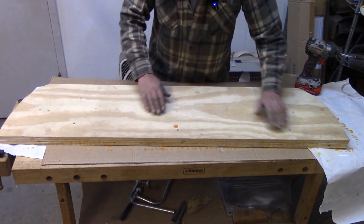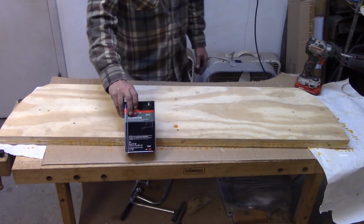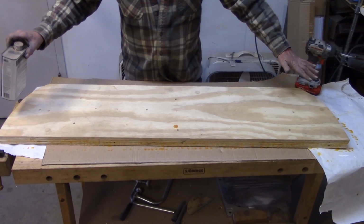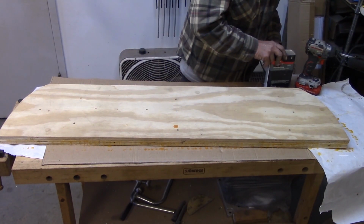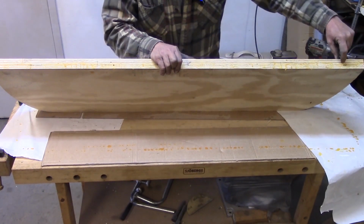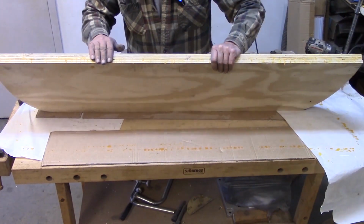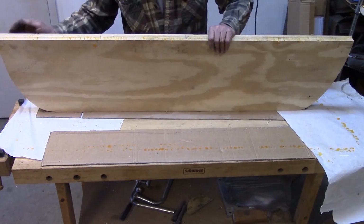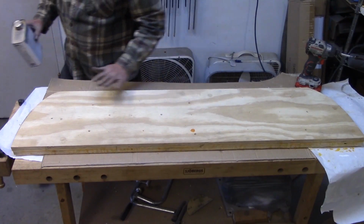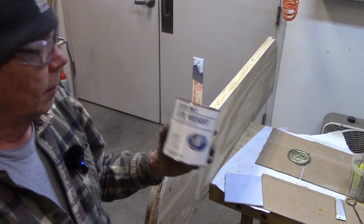and then I'm gonna clean this glue off of the edges all around it. And then I'm gonna use some fiberglass resin that I'm gonna cover this whole thing with. Front, back, tops, and sides, the whole thing. Now, if there's any places like this, I'm gonna go ahead and Bondo those up too. I want a nice flat surface to put this resin over top of so I can seal this thing up and make it watertight. I'm just using regular body filler.